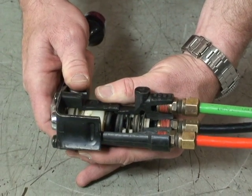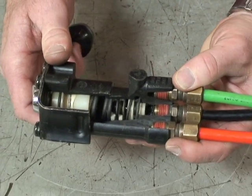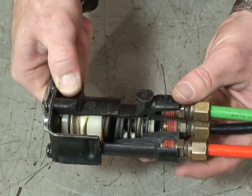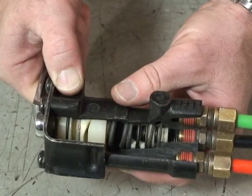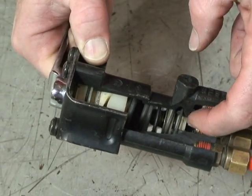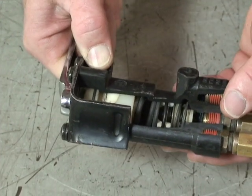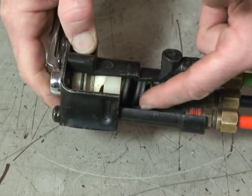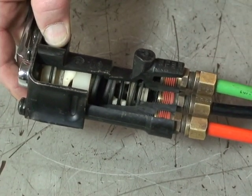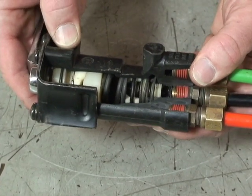The spike has a balanced and unbalanced position. As we pull on the lever, there's an eccentric cam here. You can see the cam is rotating, pushing down on the relay valve inside here, which closes the exhaust valve. And then as it continues to push down, it opens up the supply air, which allows it to go out to the delivery to the trailer service brakes.